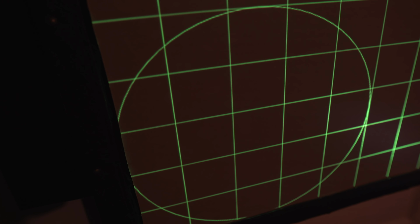Let's talk about the focus. As for focus uniformity, with my particular unit, if I got the center perfectly focused, then the four corners would be roughly 3 clicks away from matching the center, so it's just a tiny bit soft. If you're sitting down, then you won't notice a thing. The Optoma so far has the best focus uniformity I've seen on an ultra short throw projector.